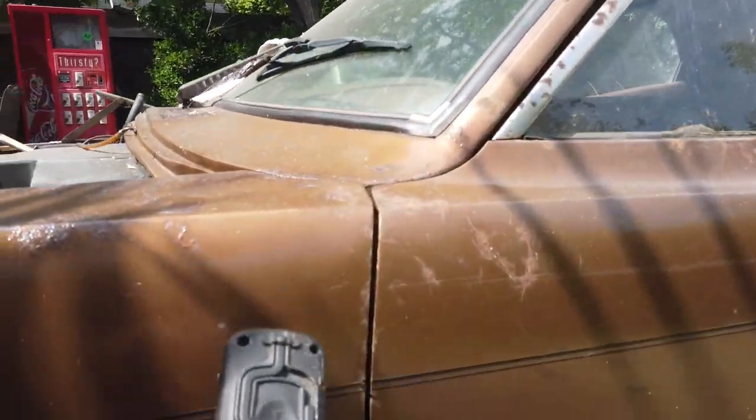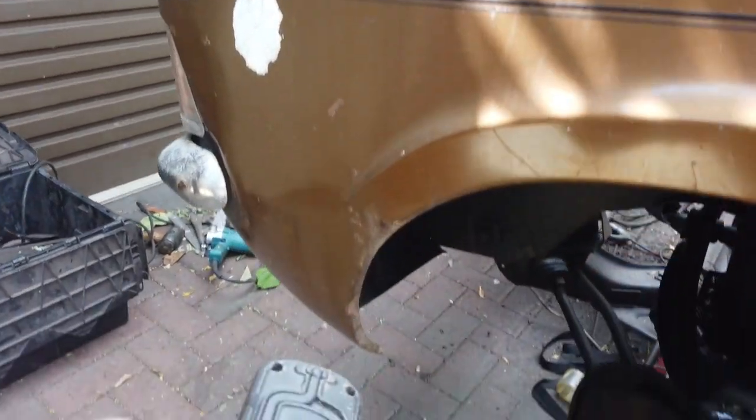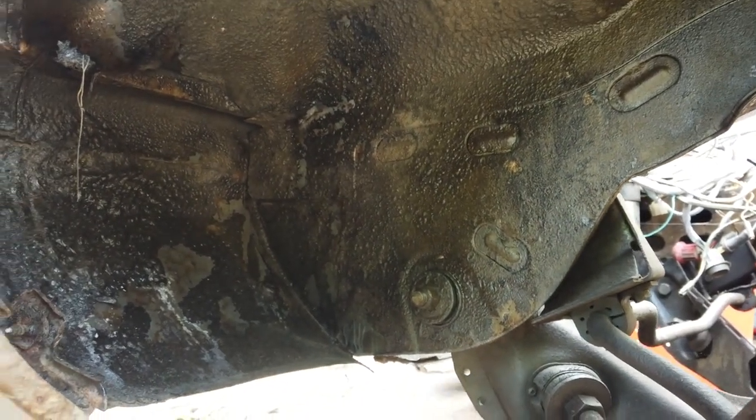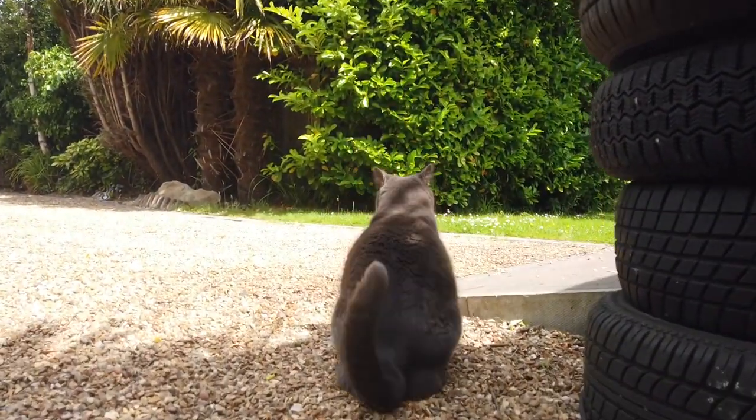Some 10-mils down this inner piece, 10-mils across the top bumper, detach indicator wire, couple of fixings at the bottom at the front of the wing and you're good to go. Let's get this off. Got a ratchet spanner on 10-mil going in with torch - there's the 10s down that run. We've got rot - more than the other side. Dollops of gunge and gook. Could this wing even be rotten? We were hoping this wing was a saver. You can see why they rot - look how it traps the mud there folks. All this rot is waiting on you too.